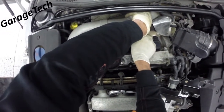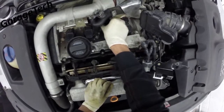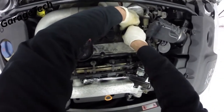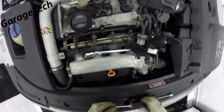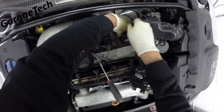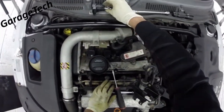You shouldn't really need too much force. Again, pull it towards you, push that clip back, then push the whole connector back. So you can see those two plugs are off. These ones are relatively easy to get out — you just need to pull them up. You might need two hands to really give it a good yank up, it will be quite tight. If you're really struggling, you might need your flat blade screwdriver to carefully lever it out. There we go, that's one out.